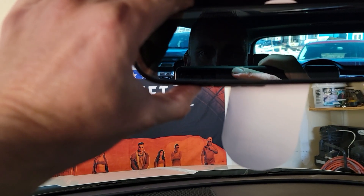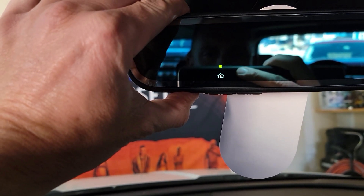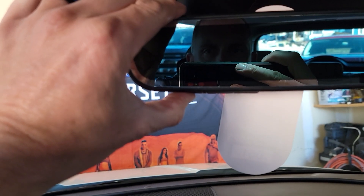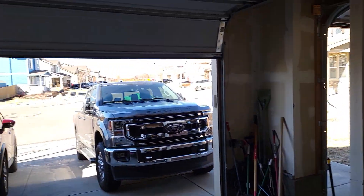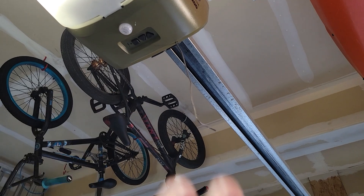Back in the car, we're going to push and hold the HomeLink button and keep holding it for about eight to nine seconds until you see the garage door move up or down. Once it activates, the LEDs on the HomeLink unit go off — you're trained and all done with that door.